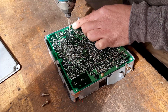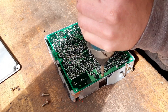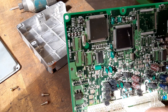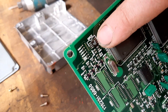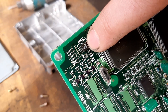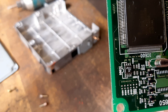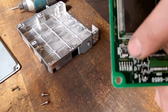So if we take the board out — on this PCB there is a little chip here. You see it? That stores all of your key programming information. What is it? A 93C56. So that stores the key IDs. We'll have a little look at that.